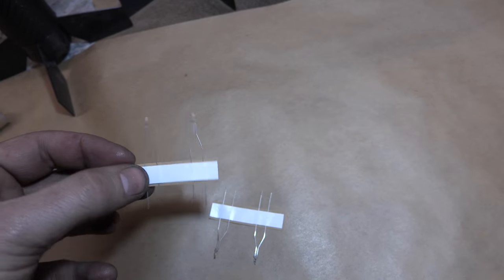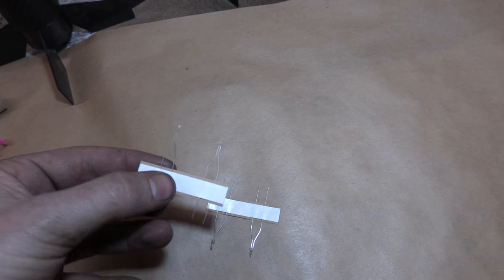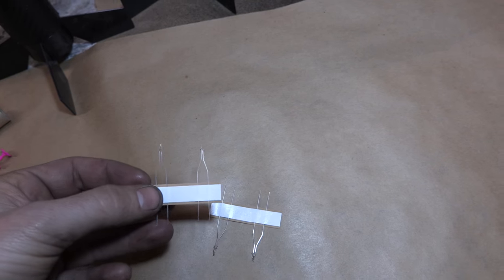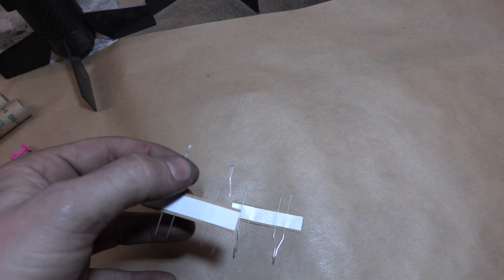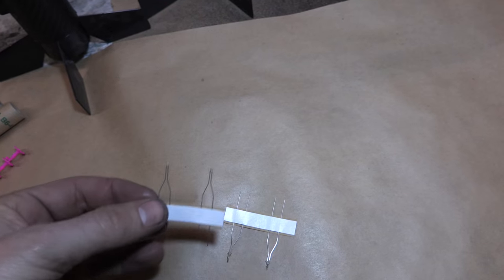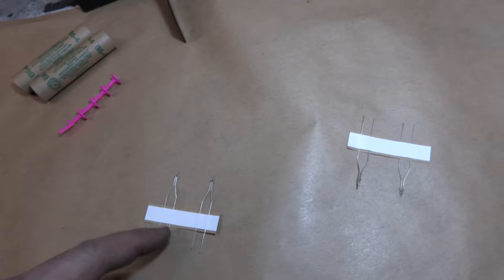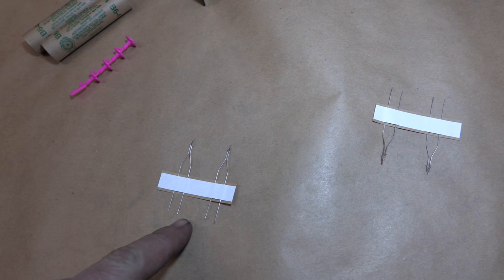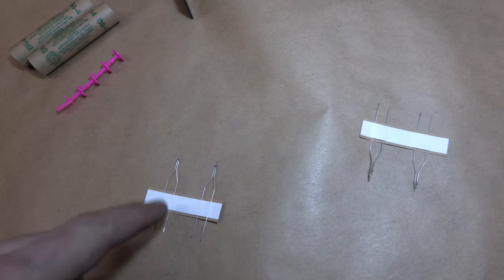And that's a really cool way if you want to wire up some craziness and continuously be able to maybe launch fireworks from a mortar or anything like that. These are definitely the way to go. If you jam one of those in the neck of a fuse, it'll light it up every single time. So you just stick one of those in the bottom of the mortar, run that out, and I'm going to wire up my ground and my hot to each one of these. Then when I flip that switch, it'll send power to this, it'll ignite this, igniting the motor and launching our rocket.